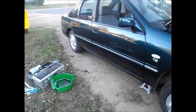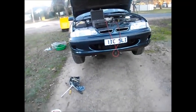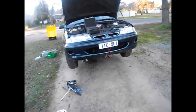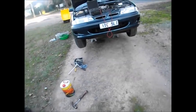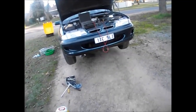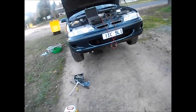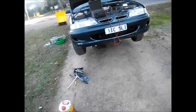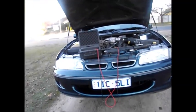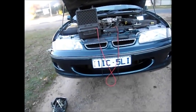I'm going to get cleaned up because I'm pretty well covered in transmission fluid. Thanks for watching and bearing with me — doing a service is actually a quick job, it's just the solenoid that's a pain. Hopefully nothing got damaged — that accumulator is kind of important; if it leaks it'll cause slipping. I'm pretty sure the gaskets will be fine. Before you drive it, just put on the brake and go through all the gears to prime up the fluid, because it's lost a bit in the accumulator. Yeah, just be kind to it.